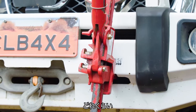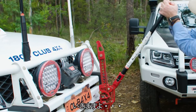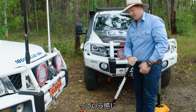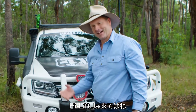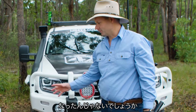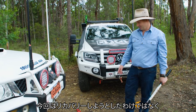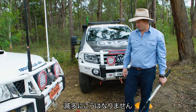Come over here and we'll see how much control we've got on the old high-lift. We're just going to flick our lever down, and out we go. Whoa. There you go folks — and that's what often happens with a high-lift jack. They are inherently unstable, and that's probably a really good lesson for a lot of people. Don't just have anyone around that vehicle at any one time. We're not even doing a recovery here folks, and we've taken a stack off there, and I didn't even see that coming — and I've been using these things for quite a while.